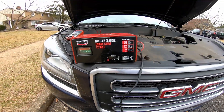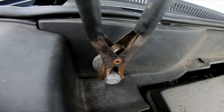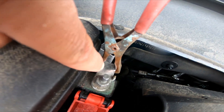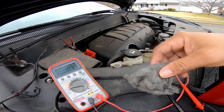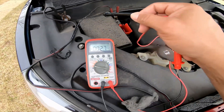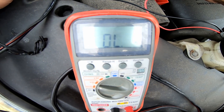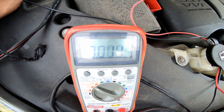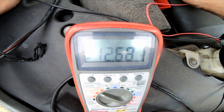I got the battery charger on there. I just cleaned up the terminals — you can see the brass a little bit here. I polished the post with quadruple-zero steel wool. I got the voltage meter here — let's see — 12.67, 12.68.